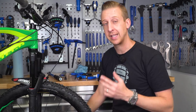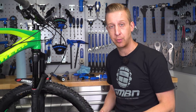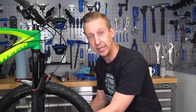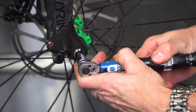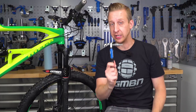The last point is the safety check. You really should be checking all major bolts and nuts on the bike. At the very least, check your contact points and control points: handlebars and everything related, make sure your pedals are tight, brakes are secure, and wheel axles are tight. You don't want anything to fail when you're riding. But don't go crazy with the Allen key without a torque wrench — you can over-tighten and damage bolts, meaning more time in the workshop and less time on the trail.